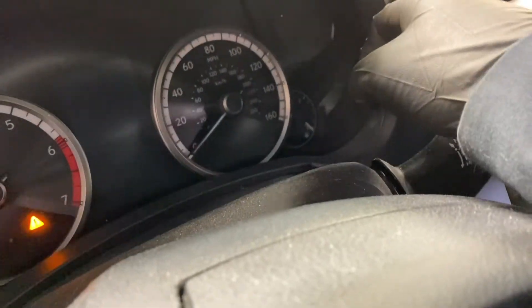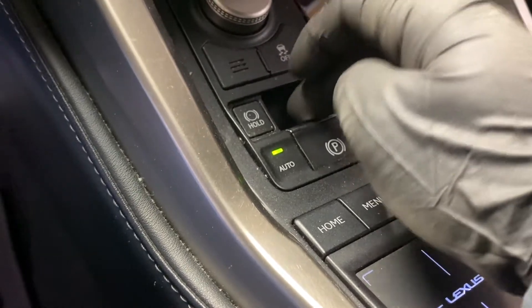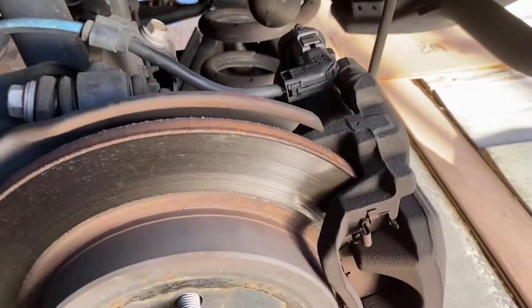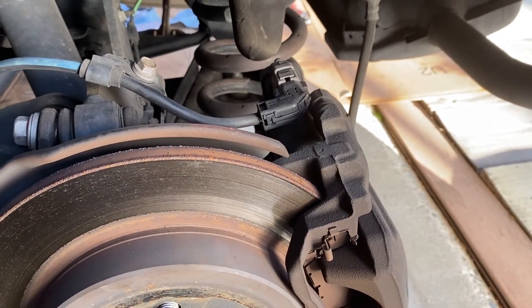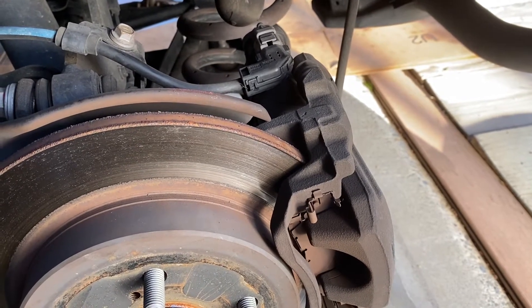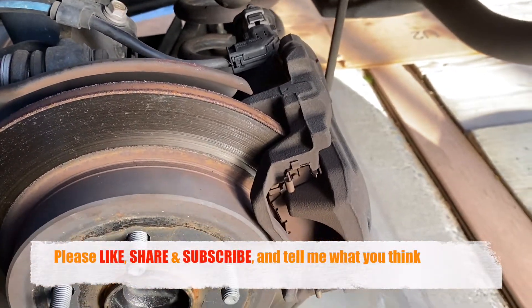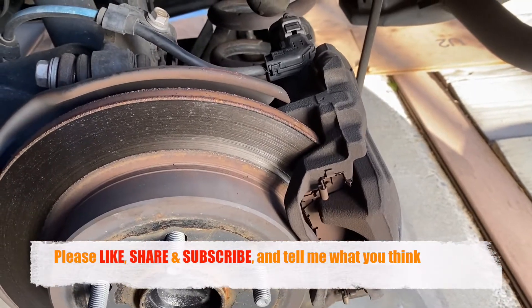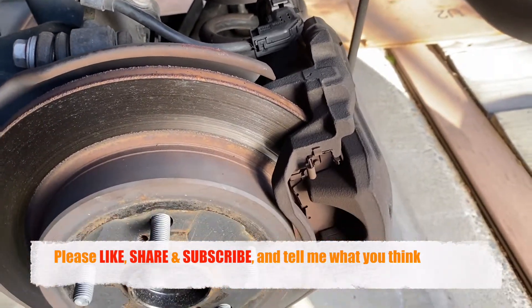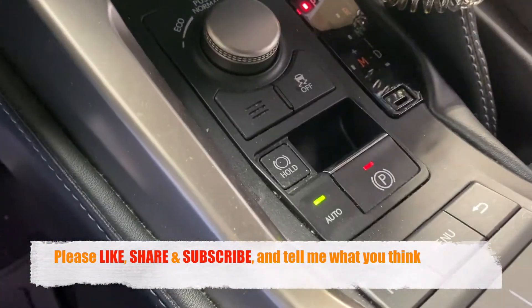Key on, then trigger the parking brake. Wait until the actuator has stopped. Once the actuator is stopped, you can put the tire back — everything's done and the parking brake is back to normal.